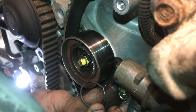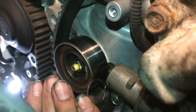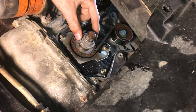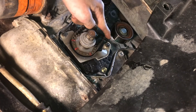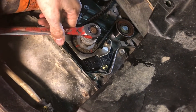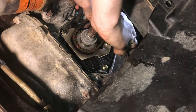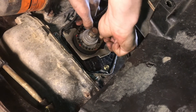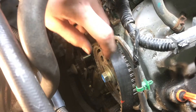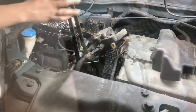If you have a thin piece of metal you can put in the hole once you have it compressed, use that. We have an extra pin here we can set in place and that's going to hold the tensioner whenever we take the tension off. There's a lot of tension on this side of the belt so I'm going to spin the crank just a little bit so the slack carries over to this side where it's so tight, so I can slide it off. Once I get it off the bottom, everywhere else is going to be pretty easy to remove. Once you get it off the bottom crank everything else really starts to come off easier.